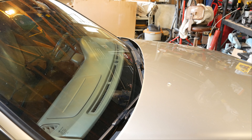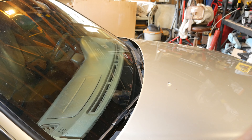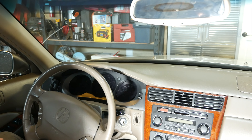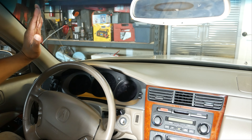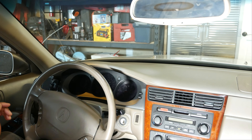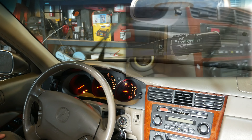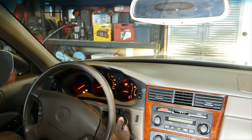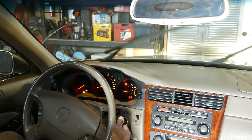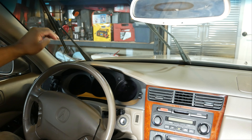The question that was posed was whether you can pull on the wiper arms and pull them up into position on the windshield so they're more accessible — I personally would not do that, and I'm going to show you exactly how I do it. I'm in the Acura RL and what I'm going to do is get the wiper blades up into position straight up so I can replace them. I put the key in the ignition, turn it to the intervals setting, wait for the wipers to come back up, then pull the key out. Now our wiper blades are in the position where we can actually take them off the wiper arms.